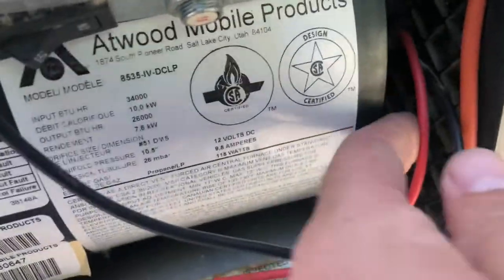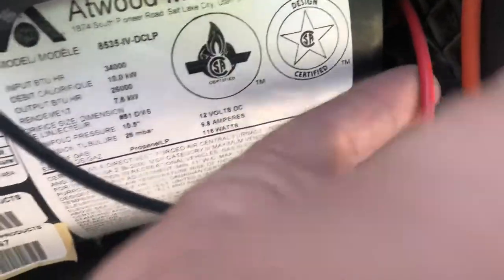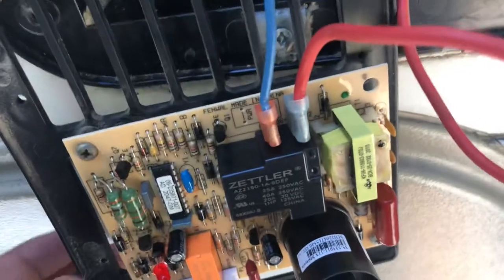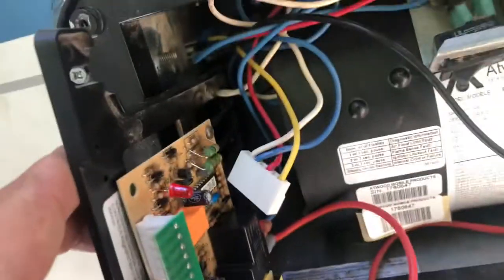You can see this says 'BLO' — that's the blower motor. That's this wire coming from over here; typically they're red. You come over here and hook that directly up to the blower spade. On the other side is the power wire, which is this wire here. When you take the old board off, snap a photo and make sure you're putting the wires in the correct place.